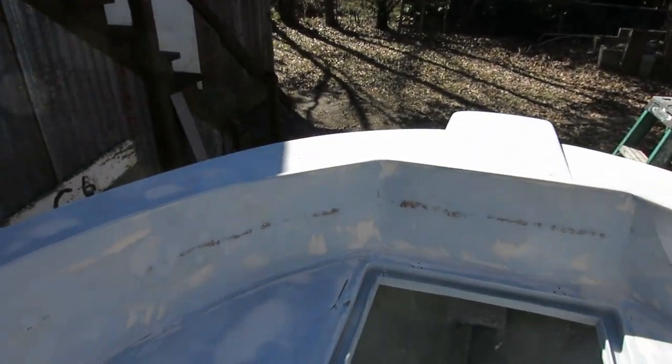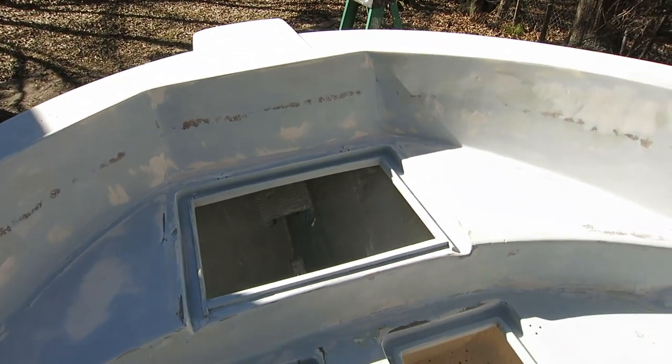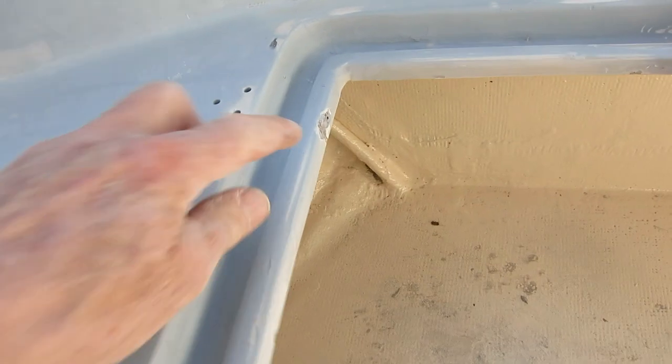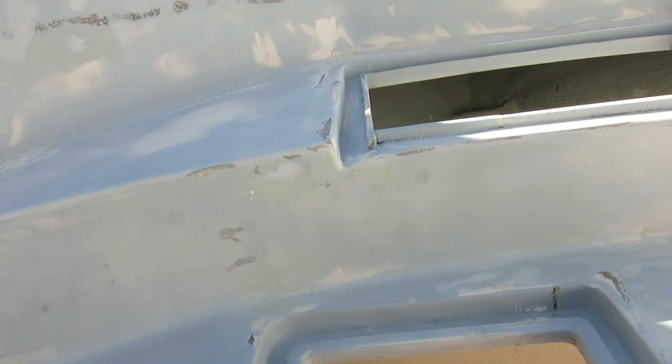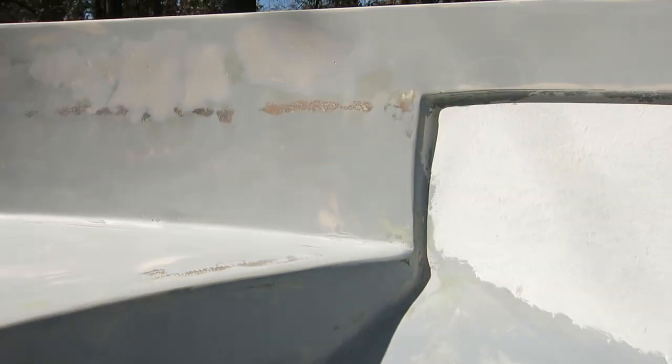This is where I am now: I sprayed with the primer, sanded it back, found imperfections, ground them out, filled them with filler, sanded again, and now I'm finding some things I just missed — I meant to get that and I missed it totally. And some of the things were filled but they just shrunk; they're a little bit low. So I'm going to do it again with the filler. It's a little bit frustrating, although it's a beautiful day. I know in my heart I'm not going to get this perfect, but yet it's hard to walk away from an obvious little ding. More filler going on right now.